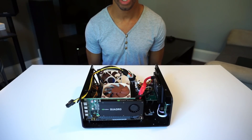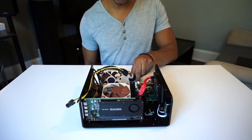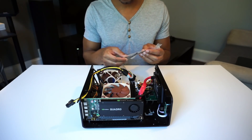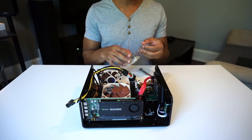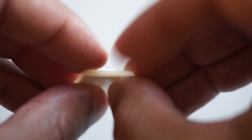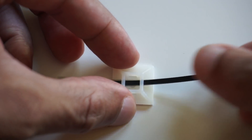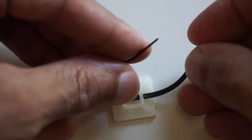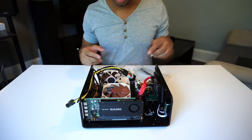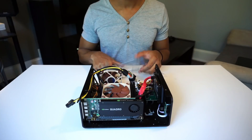Here's a quick tip. In cases where cable management is an issue — like small form factor cases like this where there's really nowhere to run cables — zip ties, specifically the tiny half-size zip ties, plus these little adhesive cable anchor clips with four slots to slide zip ties through, can be a lifesaver. They have tape on the back. I have zip ties going all over these cables, holding the power cables down. They're really a lifesaver and super cheap — these are like three bucks, this was like two bucks.